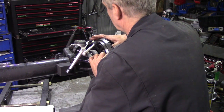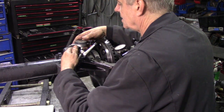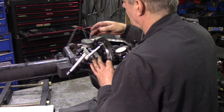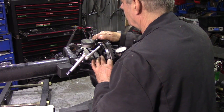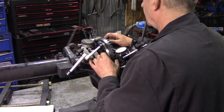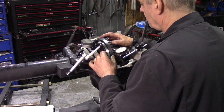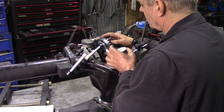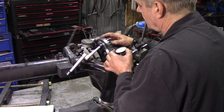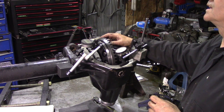So we've got this here at zero. That's 6.065. So we want ten-thousandths backlash - we're going to set this. Now the crown wheel is touching the pinion. We're going to set our gauge to zero. In the book it's actually 6 to 11 thousandths. So we're just going to move this a little bit.